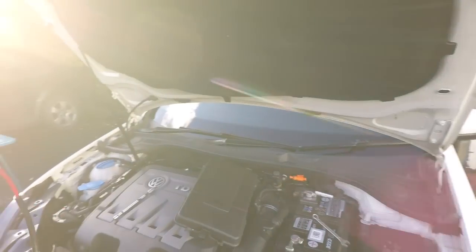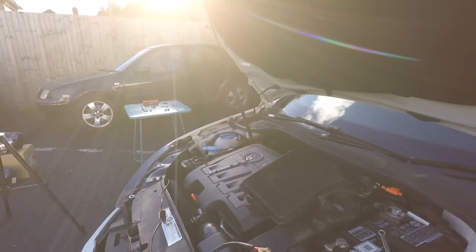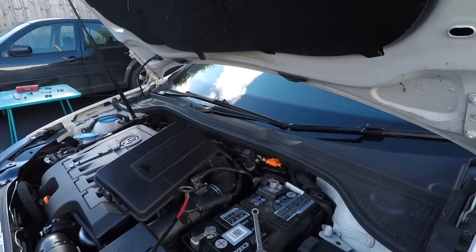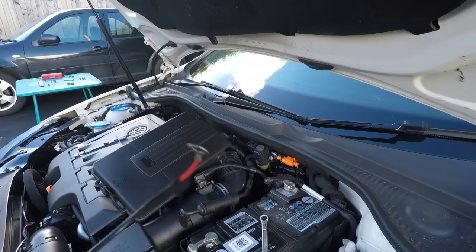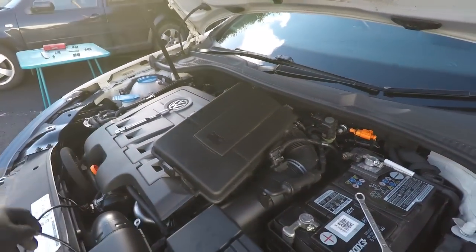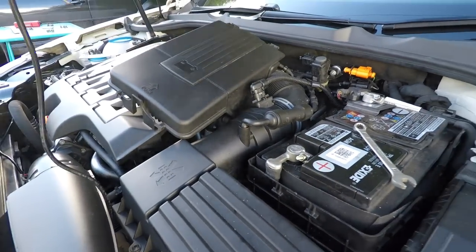So we've got this cable now that runs across the front of the car. As you probably know, there are radiator fans that rotate at high speed at the front of a modern car, so you need to make sure that when you run this, you run it away from them. So it's probably easier to somehow get it around behind the air scoop here. And then underneath.